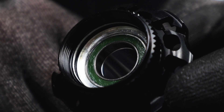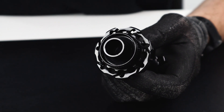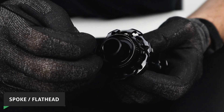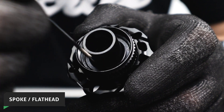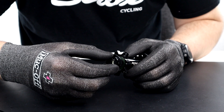For the 15mm installation process, place the disc side adapter into the hub shell. Then while using a spoke found in your service kit, push the seal down past the inner ridge, ensuring that it is secure the whole way around the hub. Once this is done, double check that it is running freely without any resistance. Then repeat the process for the non-disc side.